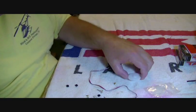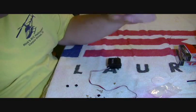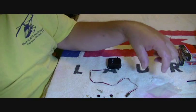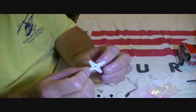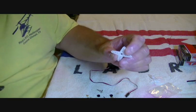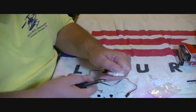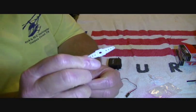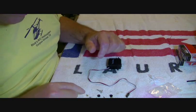I'm going to keep my little baggie to put the excess in. It will come with a big round horn — if you use it you have to drill your holes where you want them. I hardly ever use those. It will come with a six-armed one and a big double arm long. We don't need one quite that long. It will also come with a four-arm. Most all servos come with this pretty much basic set of horns. What I'm going to do is clip two of those off and just make it a double — one side for the steering linkage and the other side to the rudder.